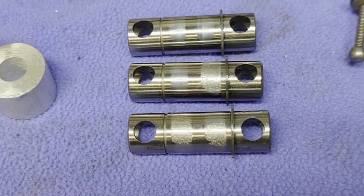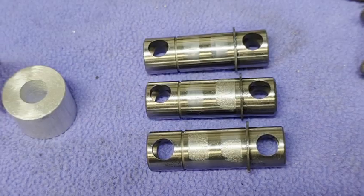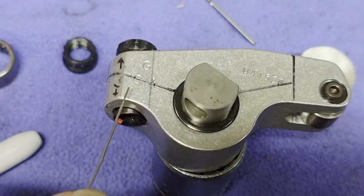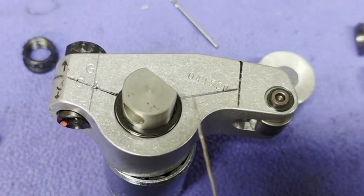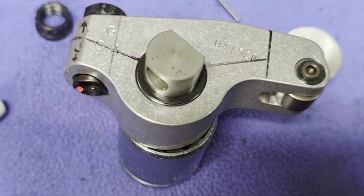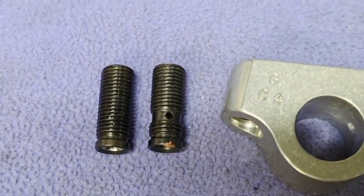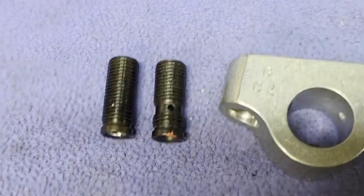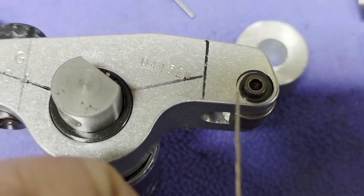I looked online at the TND site — I remembered something about pressure oil-fed bearings on their top-end roller system. To pressure-feed lubricate the bearings, you have to drill a hole here and another hole to feed the roller tip. The oil comes up through the adjuster. The original adjuster has a hole that goes straight through and out the other side, so all the oil just goes up, hits the tappet cover, and splashes down — lubricating the shaft, the roller tip on the valve, and the roller shaft.